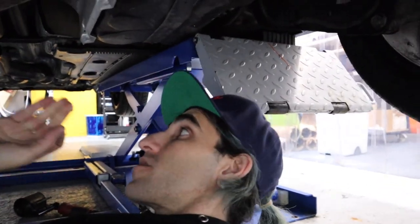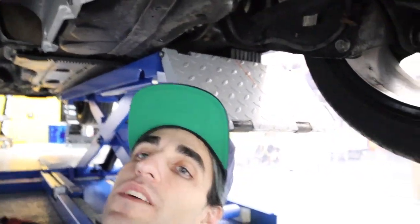I'm going to take off the exhaust hangers - there's a bolt over there. I'm just going to try and wiggle this one off, and then these ones are bolted on again - I think I'll just unbolt it because it might make my life a little bit easier rather than trying to squeeze the rubber out in this small gap. So this one's going to be the only annoying one, but we'll cross that bridge when we get to it. Unbolt, unbolt, unbolt, and in theory that is the exhaust off.